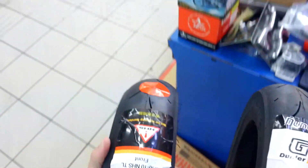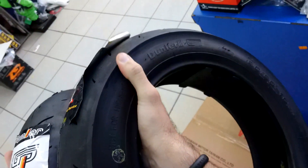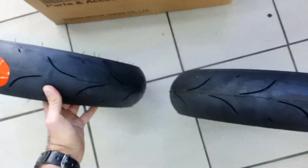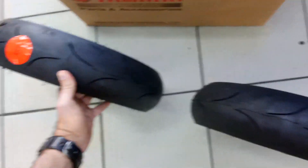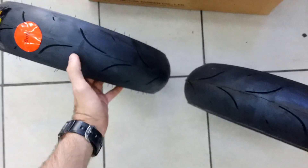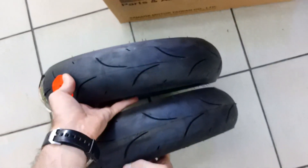So yeah, it's odd. Like, I didn't believe him. The tire is made to go one direction. Here, let me show you. This is a front tire and this is a rear tire. Check the arrows — this is the rear and it's supposed to go like this, and this is a front and it's supposed to be like this. When you look at the groove patterns, they're actually opposite. But that's the way it's supposed to be. This is a front tire facing the right direction, and this is a rear tire facing the right direction, and the grooves are reversed. So if you take a front tire and put it on the rear, you have to reverse it. Same thing with a rear tire — if you put it on the front, you've got to reverse it. And when you reverse it, they match.